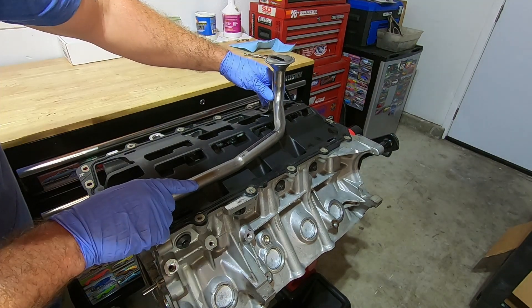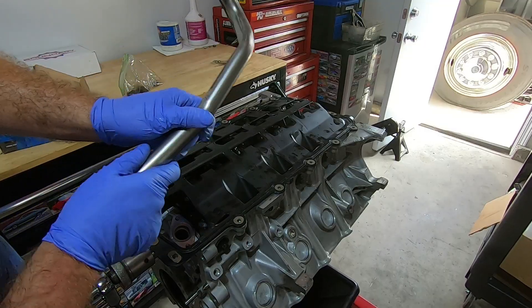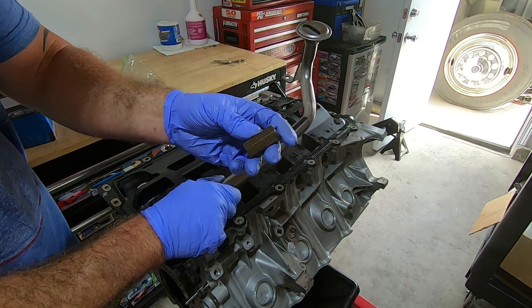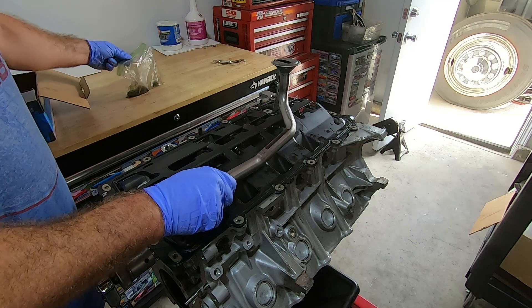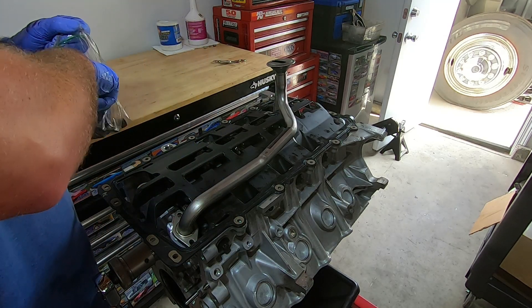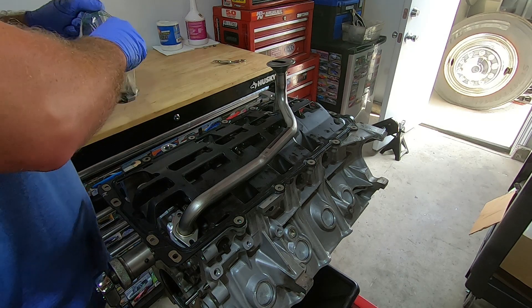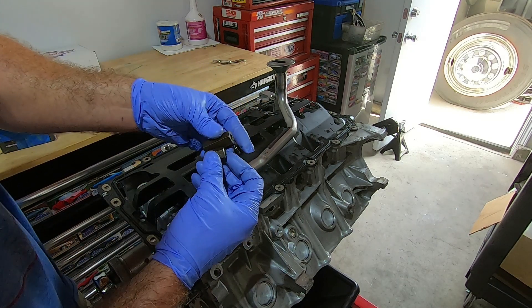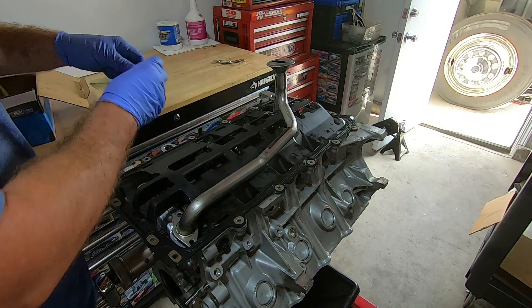That's actually really good as well. Now for the pickup tube, I'm going to go ahead and put in one of these little hex spacers — they make them in different sizes, they just come out of different engines. There are longer ones and shorter ones, but the gap I'm seeing there looks like I need one of the longer ones.